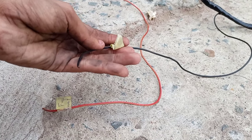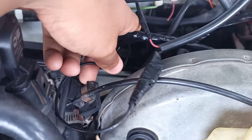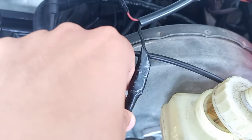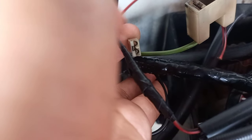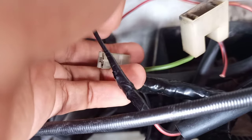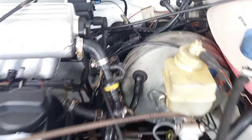The next cable after that is your ignition wire, and this one you actually have to do a bit of cutting and joining. The loom runs here, and you can see the cable poking out and joining up. This is a wire from the pre-existing original loom that the car comes with. We made a connection from the short loom to the old loom using a lug to push in to connect, and we used insulation tape to wrap up the two cables.